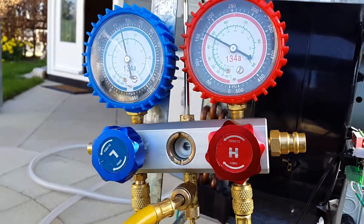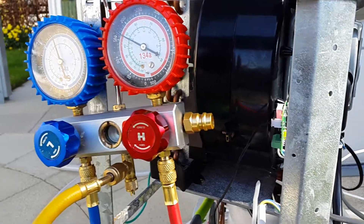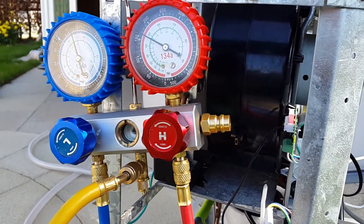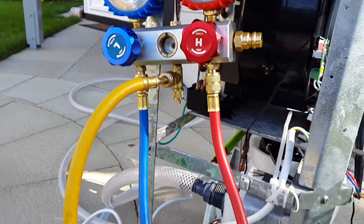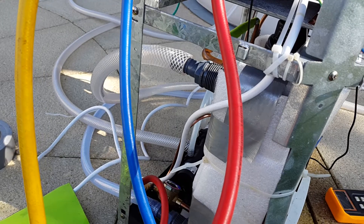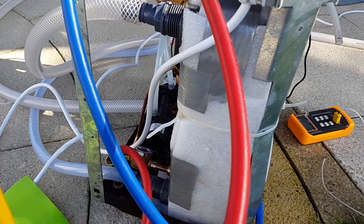These are the pressures. I've managed to get it filled correctly with refrigerant and the whole evaporator is now being utilised properly. I think eventually I may shorten the capillary tube, though that might be a bad idea — a capillary tube works well at certain conditions but not others, whereas a TXV will work better across all conditions.